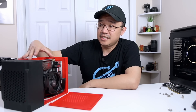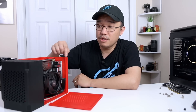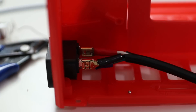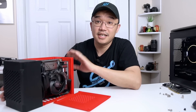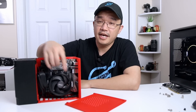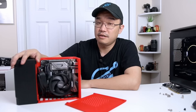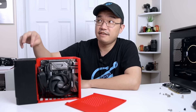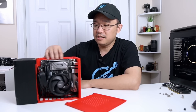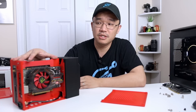A couple of things you have to put together yourself on this ITX case: the power supply button — it's a 20 millimeter button and you just have to find some way of hooking it up to your motherboard — and also the PSU power supply. I was able to find these little three-prong connectors for the PSU. This is a very, very snug fit on everything, including the power supply cable, the motherboard cables, and the CPU pin cables. I was able to fit everything in. You definitely need a modular power supply — this is the SFX or SFF small form factor power supply going in here. Everything fits very, very snug. I also put a placeholder for a graphics card on the other side, because this is the only 170 millimeter graphics card I've got.